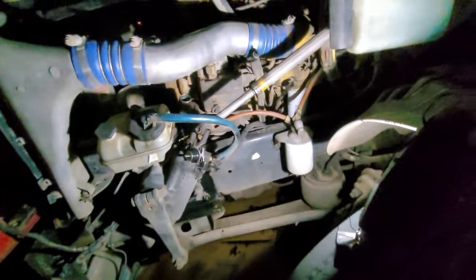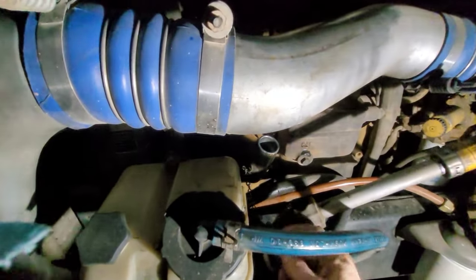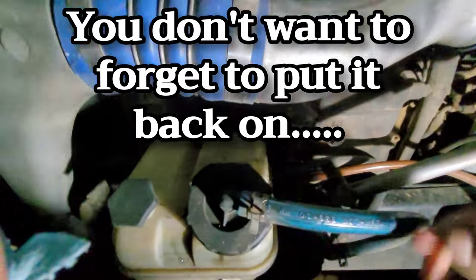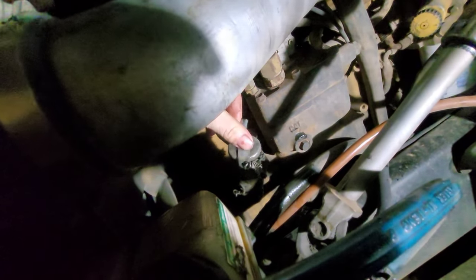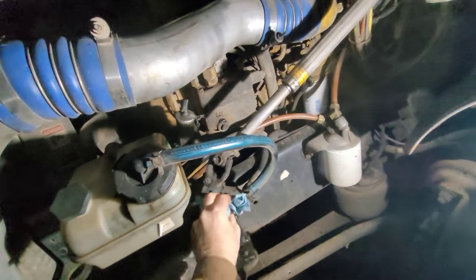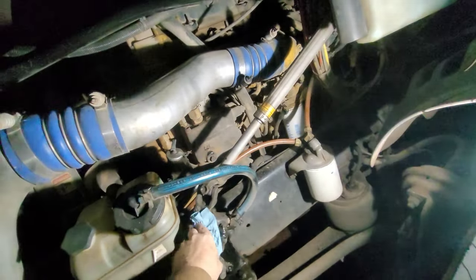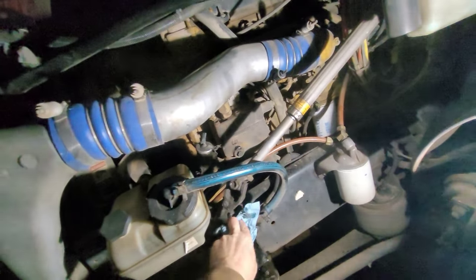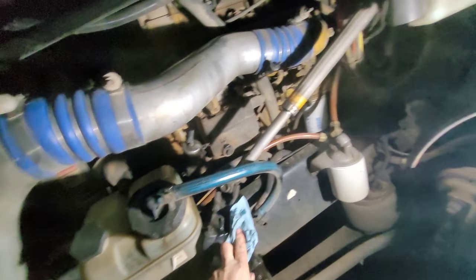We're finally finished up. Let's go ahead and put this cap back on - that's one thing you sure don't want to forget, because people are just ready to close the hood and be done and forget about stuff like this. Make sure the dipstick is down too. We'll check the oil tomorrow morning when it's all settled. Start it up, let that oil filter fill up - if you check it right now it won't be right because it hasn't filled the oil filter yet, so you've got to wait until it fills up and then check it.